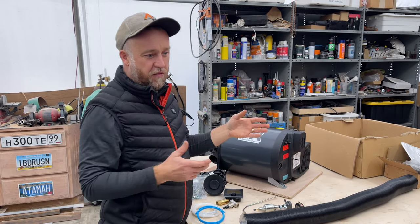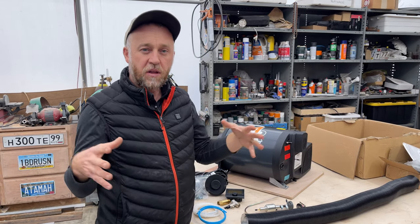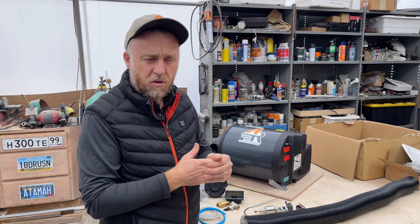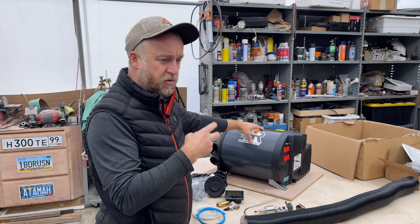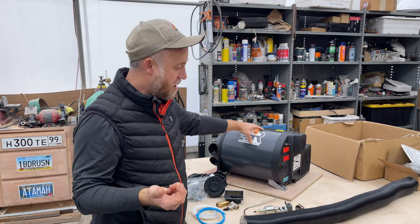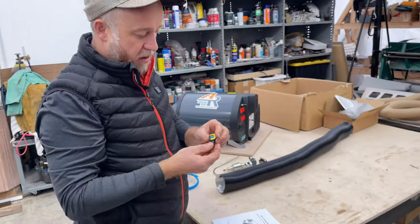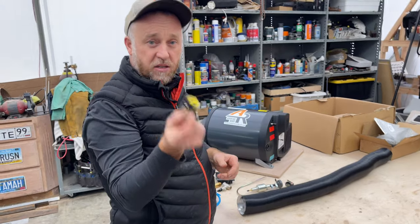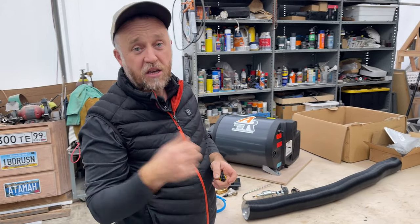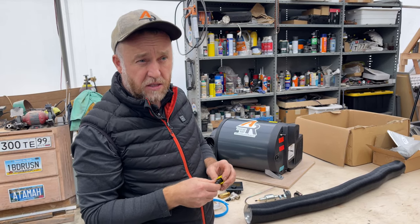You don't have to worry about having a separate diesel heater fuel cell or propane, because in this case the customer purchased this van with an extended fuel tank — I think it's around 35 gallons. Being able to tap into that tank makes it very convenient and simple. We tap into the tank via what is called an auxiliary fuel port, which comes factory installed — at least in this van.